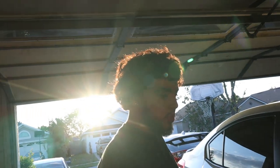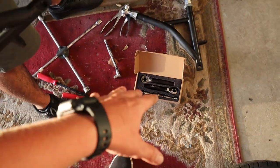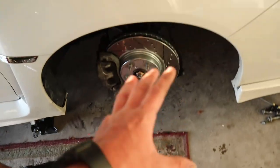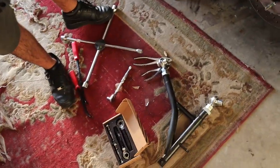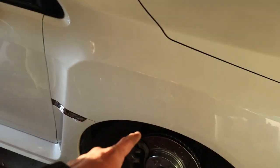but should be worth it for Subarus. The RacerX front lowers are just to prevent axle binding at the front and allow you to get the correct toe, because without those, you'd be toed in way too much to even drive it on big camber. So that's what these are for, and that's what the slotted top hats and coilovers are for.